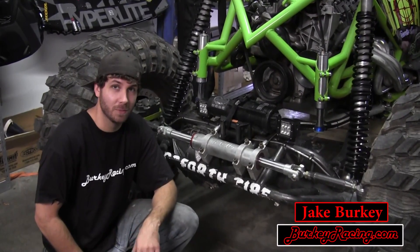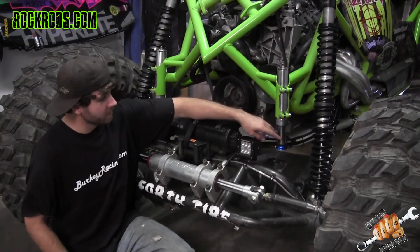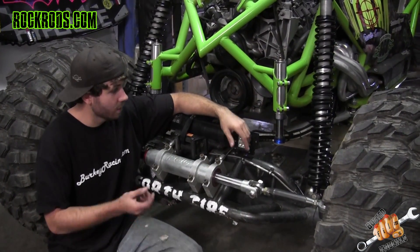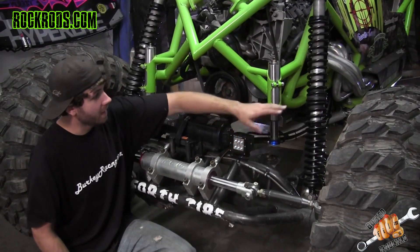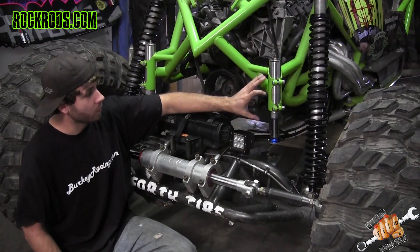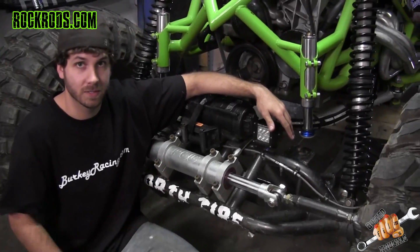Now that we got the shocks rebuilt on this rig, we're going to look into some other things that are going to help the suspension. These bump stops are four-inch bump stops and they're only two inches off of the pad, so when the suspension compresses it goes up two inches, hits the bump stop, and he's riding on full bump all the time. In order to utilize the valving changes we did in the shock, we're going to go internal and put a shim inside to make these bump stops from four inches to two inches, allowing the suspension to do what it's designed to do.